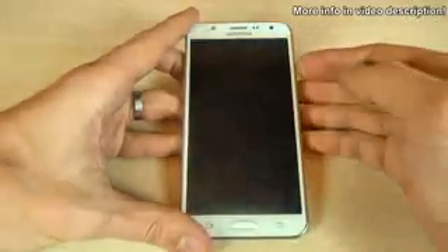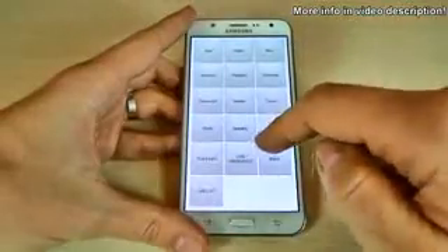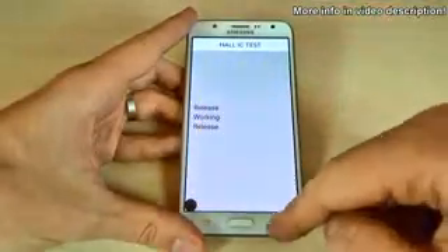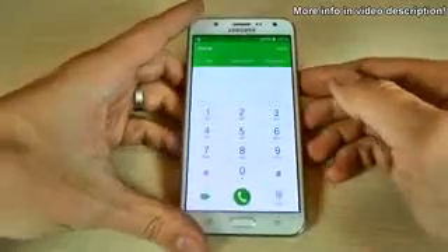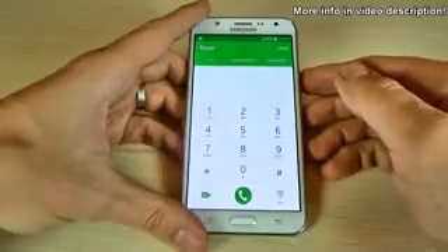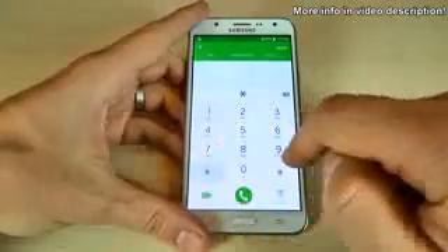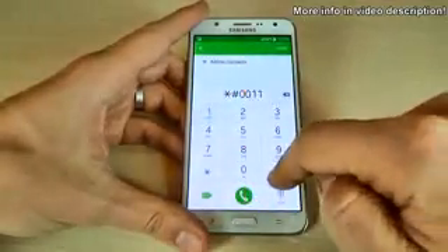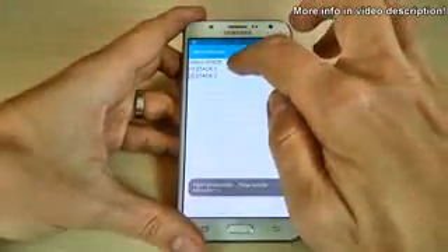This is the black test. We also have a magnetic test, though I'm not sure exactly how it works. Let's go back and try another code — this is the service mode. Just type asterisk hash zero zero one one hash to enter the service mode.